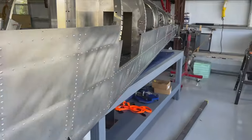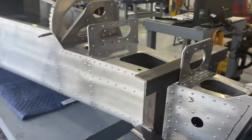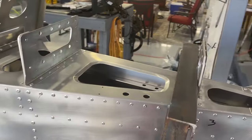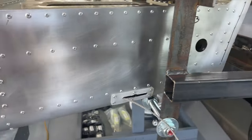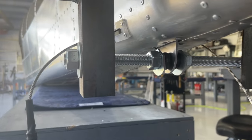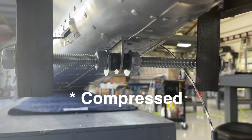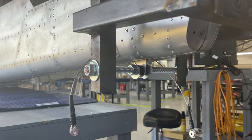We'll go down here to the rear — this is a little bit more involved. Essentially, this is a halo that surrounds the entire tail cone. This angle is attached here at that bulkhead with those four bolts. And then you can see these welds — we've welded this horizontal. Down underneath, there is a three-quarter inch threaded rod that goes through the tie-down, and that's secured in place and supported by a rubber hose. Just put a washer on either side and then clamp down on that to keep it from moving around.